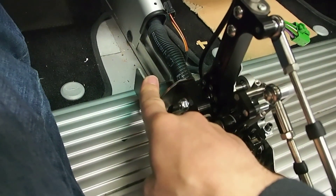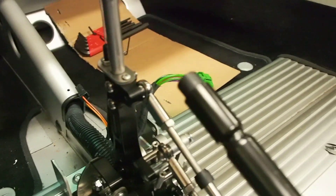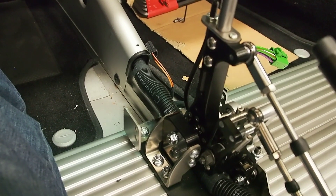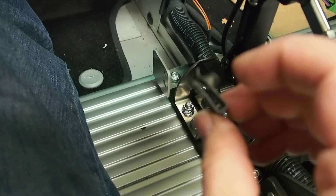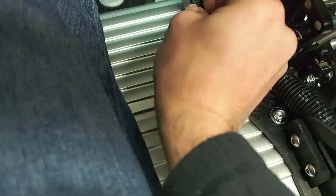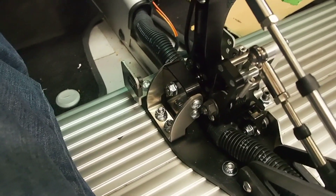InnoKinetic replaced the console cover bracket with one that was folded in the right direction, fixing a manufacturing defect. I'm now going to install the shift console cover. Instead of using the little green plastic tabs that hold the cover in, I went to the hardware store and bought some M6 U-nuts and M6 bolts to use instead — a little bit more secure than the plastic and self-tapping screws.